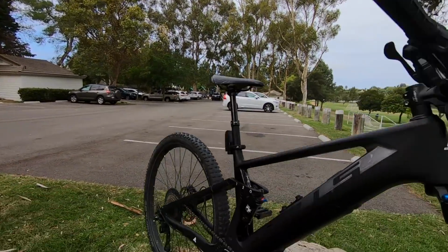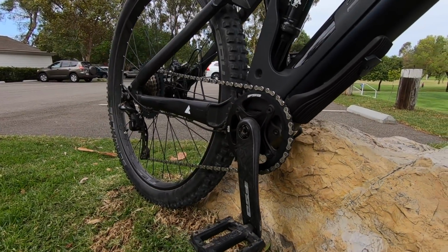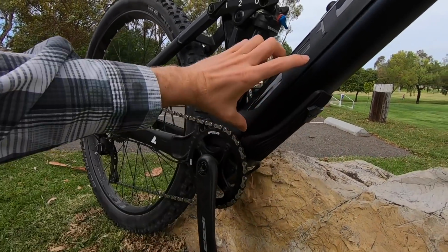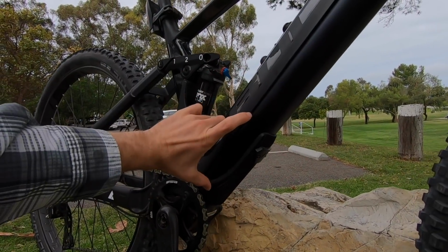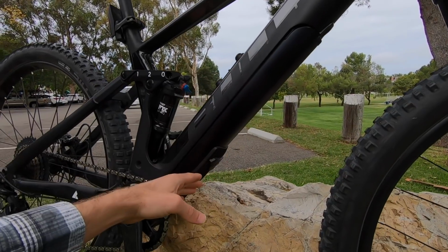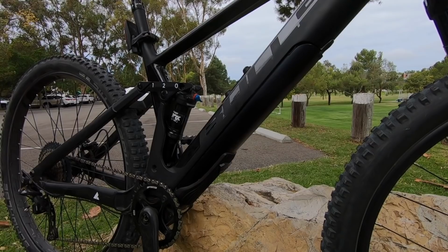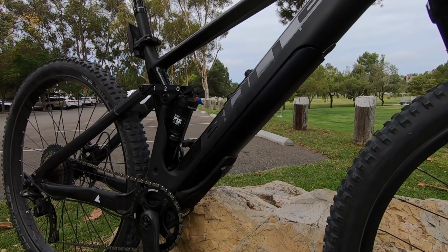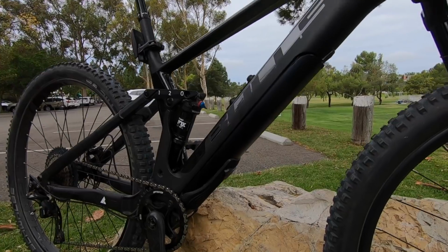drive system. So down here, 2.8 pounds, there's like this little bottom bracket, and it interfaces with the motor drive unit that's actually inside this tube. This is not all battery. Like half of it is drive unit, and then the top half is a battery pack, and the battery can slide out of it, and you can replace this whole thing with just like an empty down tube cover and use it as storage for like some tools, maybe like a pump or extra tire, things like that.